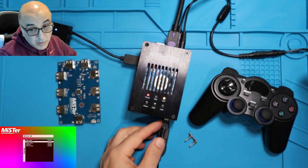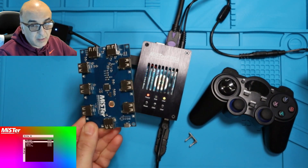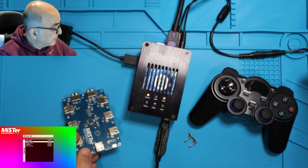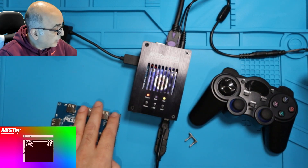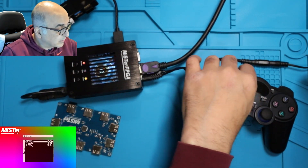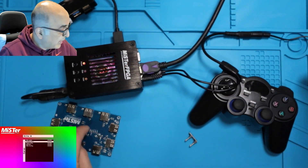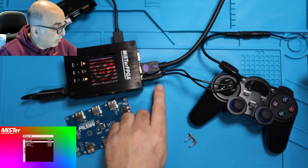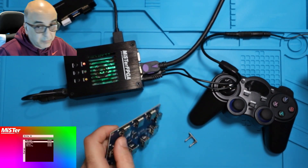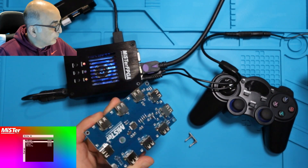If this doesn't work, you've concluded that the hub is bad. These hubs can go bad if you accidentally powered your unit with the wrong adapter. When you plugged in your power adapter, some people connect a 12 volt adapter instead of a five volt adapter, and that does blow out this bridge. So if it gets 12 volts through the Y cable, this chip will fry. Most likely then you will have to replace this board.